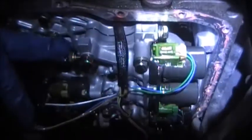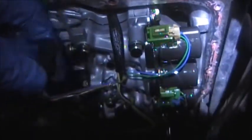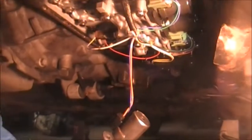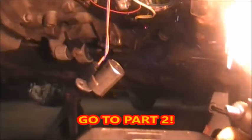You just take out the EPC solenoid with a bolt and install the new one. Now I'm going to hook that bad solenoid back up inside the transmission and reconnect the transmission case connector to the vehicle harness. Then I'll go to the computer on the inside and test from the computer down, so you can see what readings you would have seen if you had tested it without taking all of this apart.